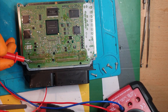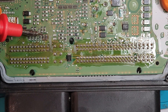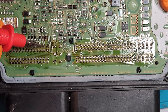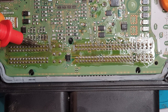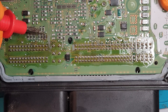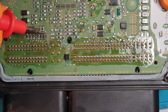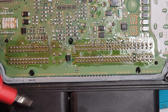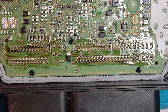And these two resistors are burnt to shit. Can you see the discoloration on these two? This is the CAN line — I don't know if it's high or low, it makes no odds to me right now. It goes off to these two, and this one here will be the other high or low. If we test the other side — nada. The problem is we don't exactly know the resistance rating of these two resistors, so I'm going to see if I've got another board and can take these two components off it and put them on this one, then see if we get our 120 ohm resistance back.